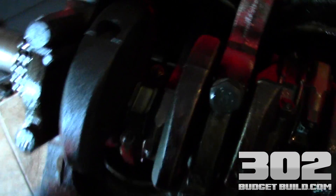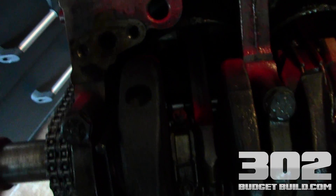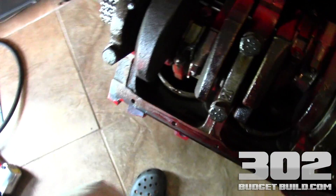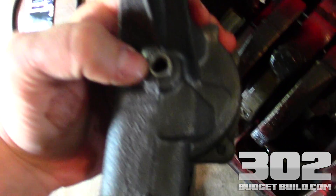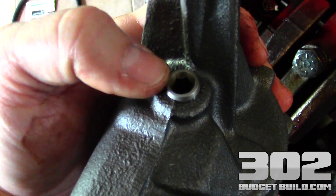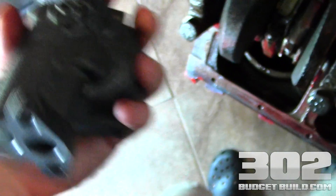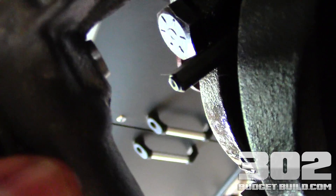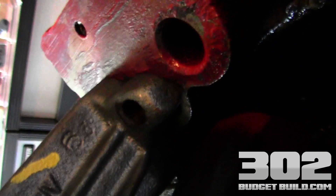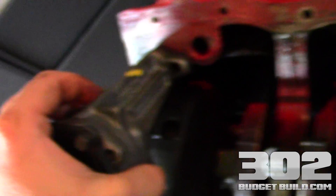Now that you have your pump, take it in this orientation — you're going to be looking down at the pump. Before you go any further, make sure the shaft goes into the allen hex area on the pump; this is what turns and pumps your oil. With the shaft visible, orientate the bolt holes and make sure the shaft mates up. With that locked in, move your pump into alignment and start to put your bolts in.